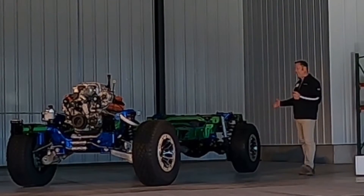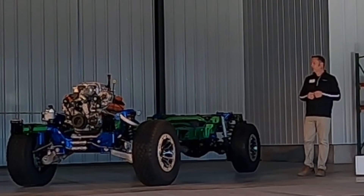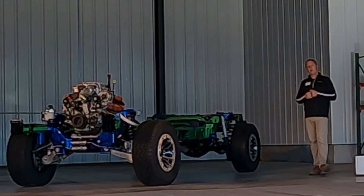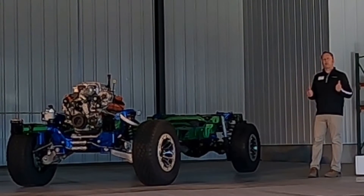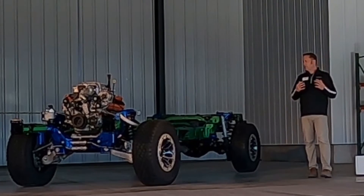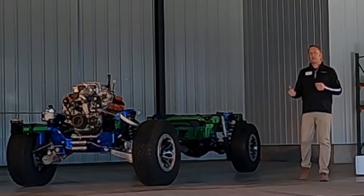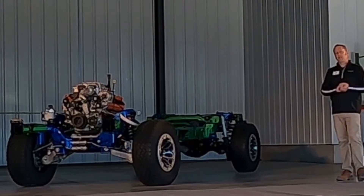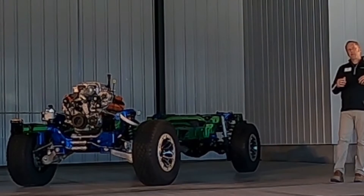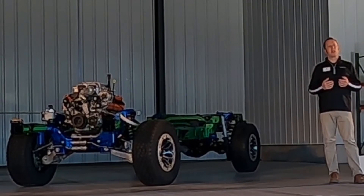At the back, we've got a Dana rear axle, and this axle is really special — it's the first light-duty segment full-floating, hub-equipped axle. All of the vertical loads from the tires when driving and punishing off-road go through the hub bearings rather than through the axle shafts, to isolate those loads and make it super beefy. It's got an electronic locking differential that's an unlimited-speed locker, and it has an axle hop damper — or what we call the axle damper — preventing power hop and providing smoother landings.